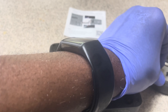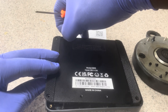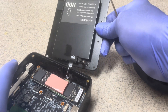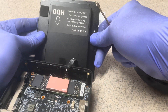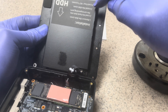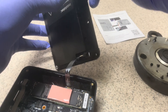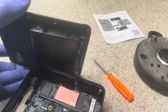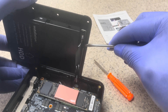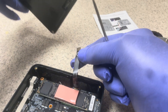The good news is at the back you will find a small tab. Hold that tab, shake it slowly, and don't force anything. You will see the cable — the cable here is holding the cover. The cover also has an adapter slot for an additional SATA hard drive, which goes into this slot to expand your storage. Take a look at the cable — it has a black tab. Put your flat head screwdriver on each side, pry gently, and the cable comes up.